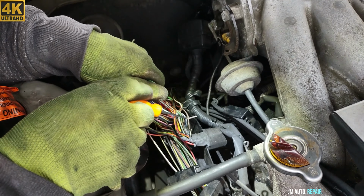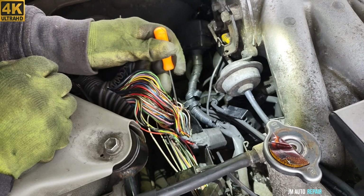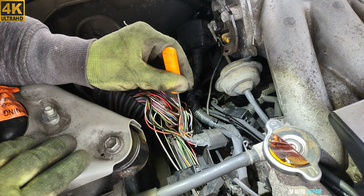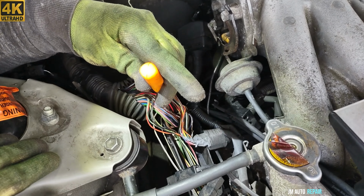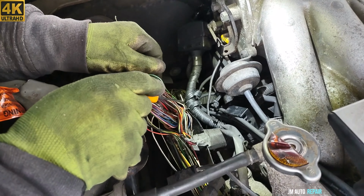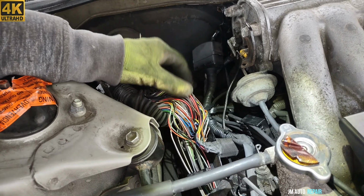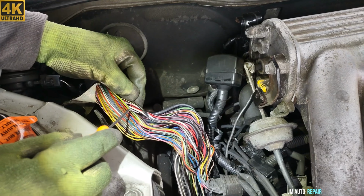This is the bare wire here, no insulation at all. And these other three, there are another three here that are stuck together, including with this one here. They are melted. Now the problem is that this wire, this one here, is going that way, and these other wires that are stuck together coming this way here. So it's not gonna be easy. And this one goes here. So luckily, this vehicle did not set on fire. It's dangerous. Now I had to ruin the entire insulation here, because I had to follow the wires.